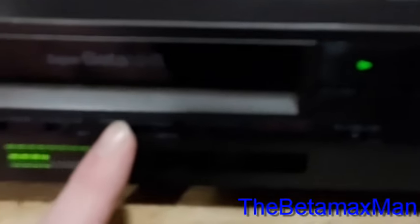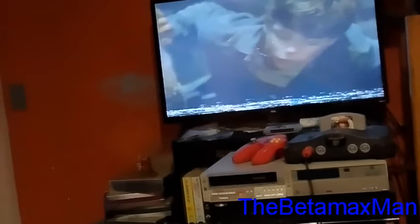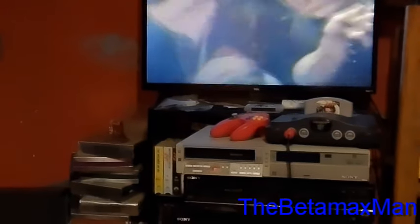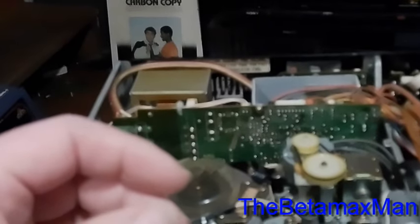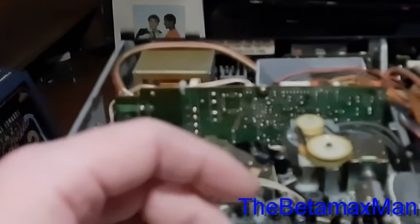Let's put it on to linear monaural sound. Now that we do that, we can hear the sound is clear. What we're getting is a drum servo issue. If the head drum is not running at the right speed, it'll cause problems. I do hear just a slight problem with the motor itself — the head drum seems to be turning and then stopping for a brief half second, then starts and stops again. That's what's causing our jumping effect.